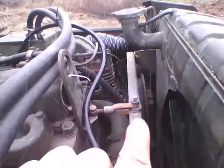And then my turbo, because of the T, runs around just by the starter there and back into that T, so that turbo is allowed to drain back freely. Now you see I'm running my line. Well, on this side, I have to put another zip tie there, and then I'll go around to the other side here, and I'll show you where I tied into the oil sample port on this. You guys can see that.